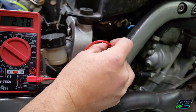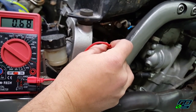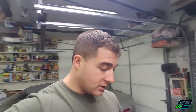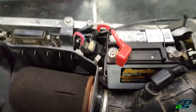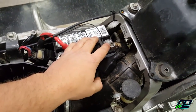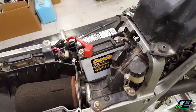That's why we checked it — we would have blasted 200 bucks on one of these things needlessly. Good news and bad news at the same time: good news is I don't need a new throttle position sensor, but bad news is I still don't know what's wrong. I'm going to start going through the wire harness, put new bolts on, check all the grounds and connections — start with the simplest stuff first.